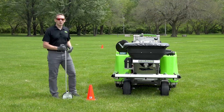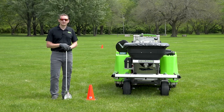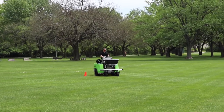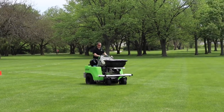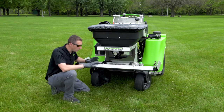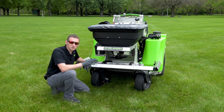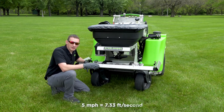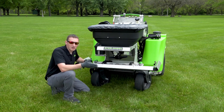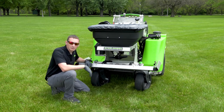I've got that track marked off. Now we can have somebody help us time us going down this track at five miles per hour and see how long it takes. We measured that it took just over eight and a half seconds, which checks out — at five miles per hour you should be traveling seven and a third feet per second. That validates our speedometer and confirms we were doing what we should have been.